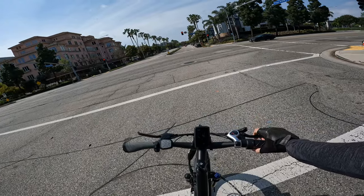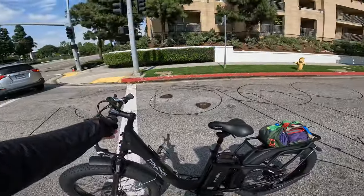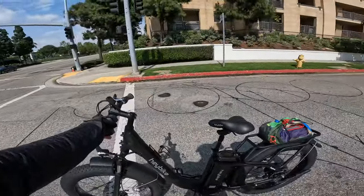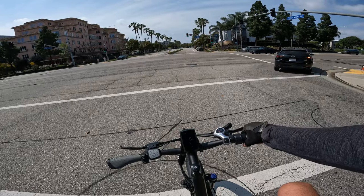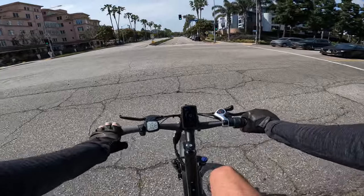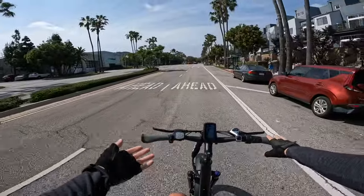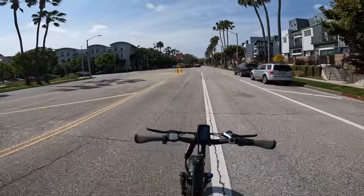Considering what you get for the money — right now this bike is $1,400. It's kind of hard to find a fat tire e-bike with a big 20 amp hour battery pack for this price around $1,400. Is it the prettiest bike? What corners are being cut? The rotors are 160 millimeters and they are mechanical disc brakes, which is a little under what's probably standard. For a bike of this size and weight, hydraulic disc brakes with 180 millimeter rotors is more standard — we'll see how they perform throughout the course of the day.